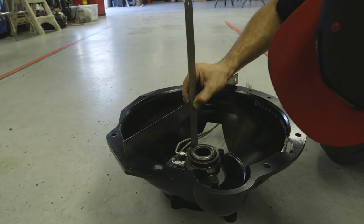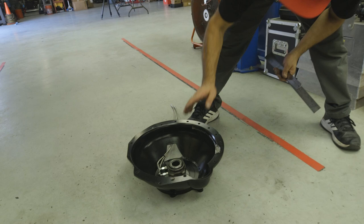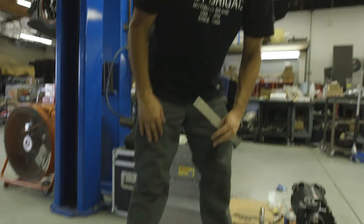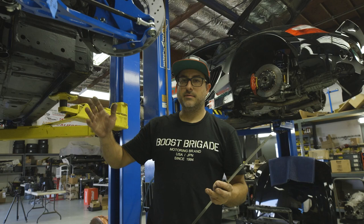Got 4 millimeters of spacing. And basically, if you have this always touching the clutch, as the clutch wears, the fingers on that clutch pressure plate start to come up. When that happens, you're gonna get pressure against the release bearing, which is gonna be trying to disengage the clutch the whole time. So the clutch isn't gonna last long. It's gonna wear out, never really grab.